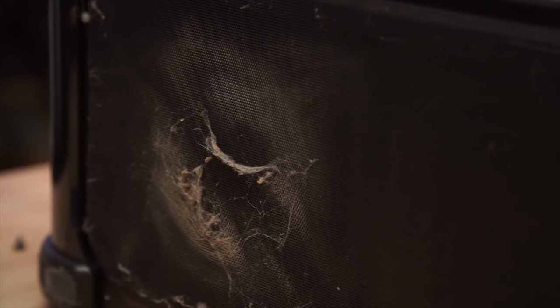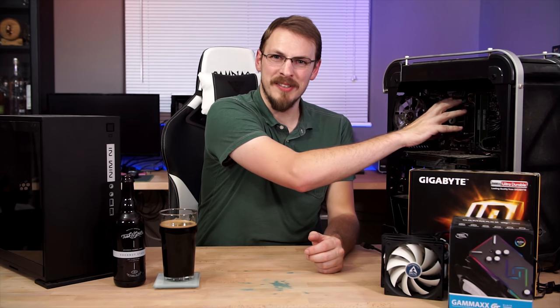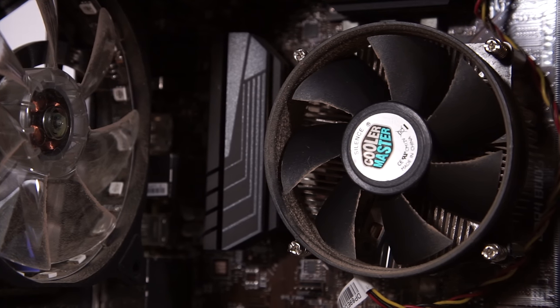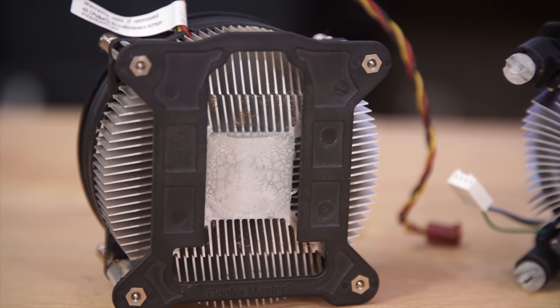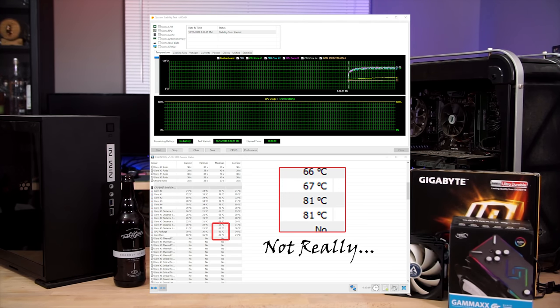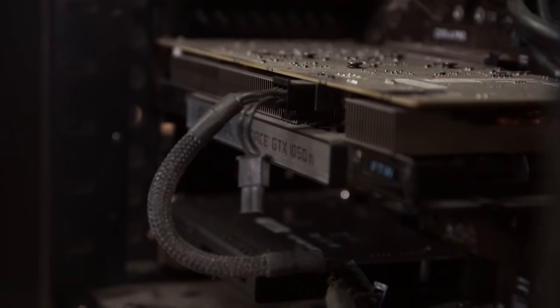Secondly, this thing runs loud and a little bit hot, and that's pretty much my fault. Not necessarily for the upkeep — the fans really aren't all that dusty, it's not caked in there. But the cooler choice on the CPU — it's literally a CPU cooler that I got on a $5 Newegg daily deal. It's a Cooler Master 92mm block and it's just a top-down fan and it's all aluminum. There's no copper in it, there's no heat pipes. So it does an okay job keeping the 8400 cool most of the time if you're just sitting there idling, or browsing the web, or even when I'm live streaming. But whenever I get into doing any kind of work — encoding video or doing any kind of audio processing — this thing reaches like 80 degrees and it's pretty darn loud.